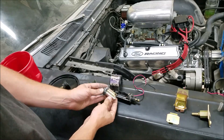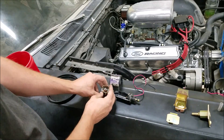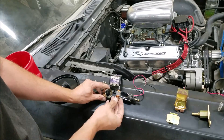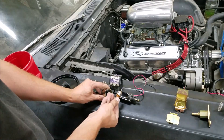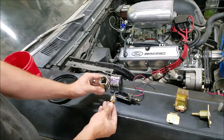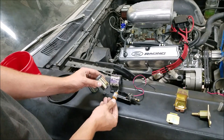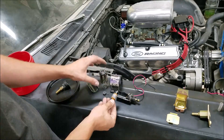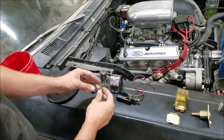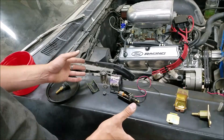That's just a quick look at how these different fuel pumps work. They're pretty neat, and I kind of always find it interesting how stuff works — a little problem I have, always taking stuff apart. This pump, five or six years ago, was in my F-100. Just like the other clickety-clack pump, it could hardly make any pressure. When it wears or if it gets dirty, there's enough slip that you just can't move any fuel forward. But this is a much better design if you're going to try and run something long-term than our little clickety-clack pump. That's just a quick look at some of these very cheap, basic fuel pumps that you'll find at a parts store.